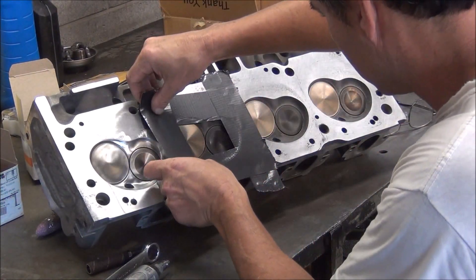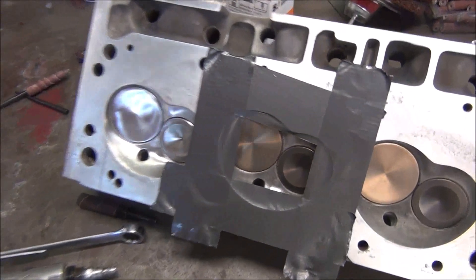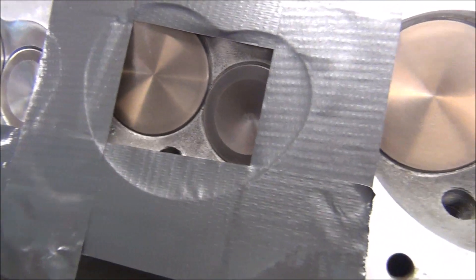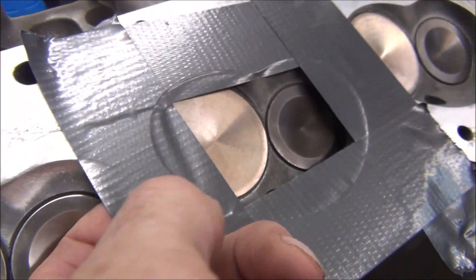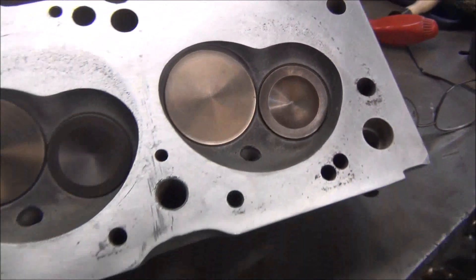Now, the whole idea of polishing these combustion chambers is just to smooth it out. This is not a perfect professional job that you might pay some very expensive head porting guy to do. This is just me trying to improve what I've got. Originally, here's what they look like. There's a big bump right there and another bump right about here. I just want to get the porous casting surface out, smooth it out. I didn't get it all — there's a little bit that's the hardest part to get to. I mostly want to get these casting slags out of here too. So that's what we're shooting for here.